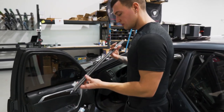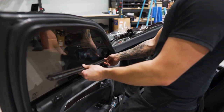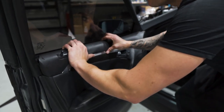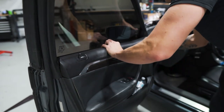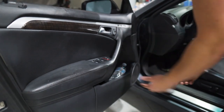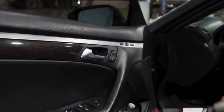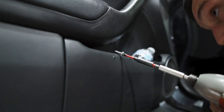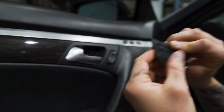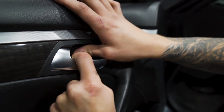Let's get back to the door panel reinstallation and this car is done. We have the gasket — these are plastic, not felt-lined, so you typically want to wipe these off before reinstalling to make sure there's no grainy dirt on them. Put it back on the channel, make sure it's sitting on there snugly, and lift the panel up. The whole key here is to wrap the panel back on top of that gasket — push it down into it, make sure the clips are clipped in. Then put the two screws back, the one screw from underneath, put the cover back under the handle with two screws behind the handle, and the one screw under the window switch. Get it on the bit head, get it into place. Last thing is to put this cover on — there's a little tab on the front, get that in first, then click it into place. Front edge in first, then click it into place.